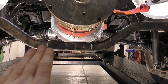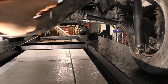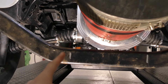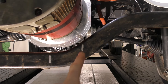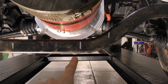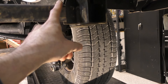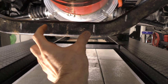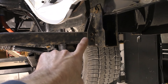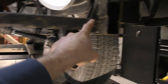That means we don't have to do as much fabrication, but the bar doesn't sit under the motor really well — there's more gap on one side. I put a level on the side of the motor and marked where it landed. On one side it lands here, on the other it lands way over, and I made a symmetrical mark. Between those two marks is two and three-quarters inches — we need to extend it. So I'm going to chop two and three-quarters inches off the end, cut it in the middle, graft that piece in to shift things over, keeping the overall width the same, then re-drill the holes. It's cut, cut, weld, weld, drill, drill — and then we should be done.